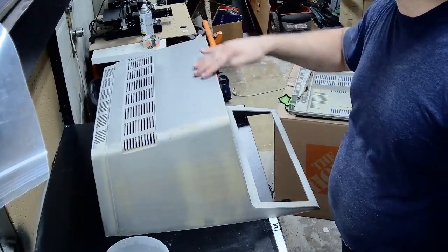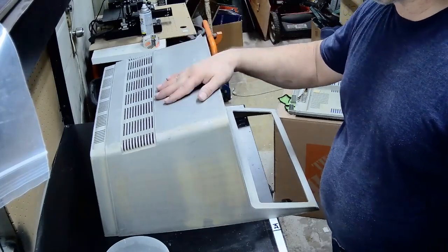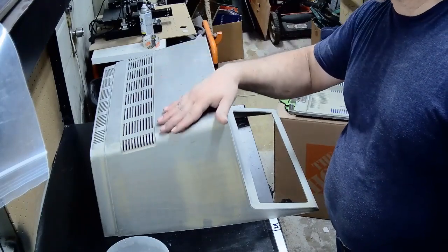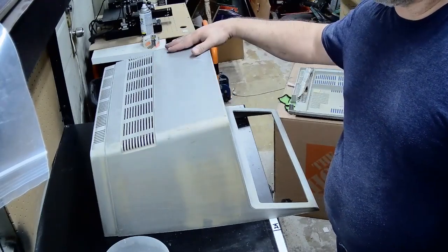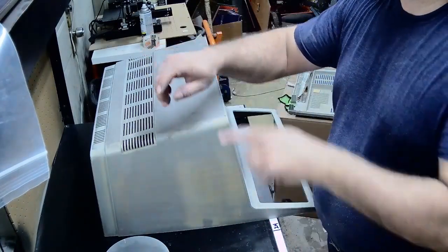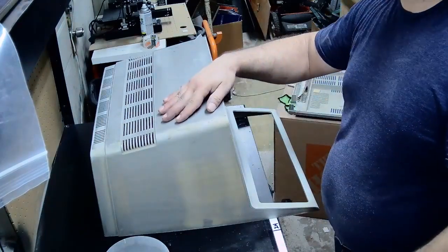There are good little grooves in it, scratches. You scratch the surface and go through the material, prepping it deeply to be ready to be painted. But it needs to have a top surface cleansing. Every little bump that you feel with your hand, when you paint over it, if you have a tiny bump, when you paint on top of it, your bump doubles in size. And then you'll have ridges.